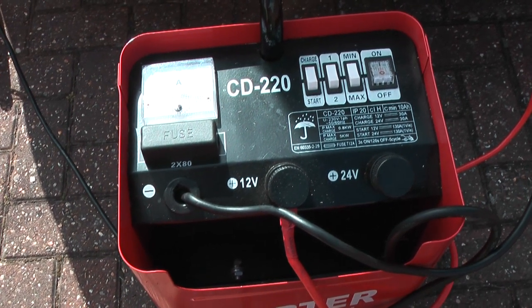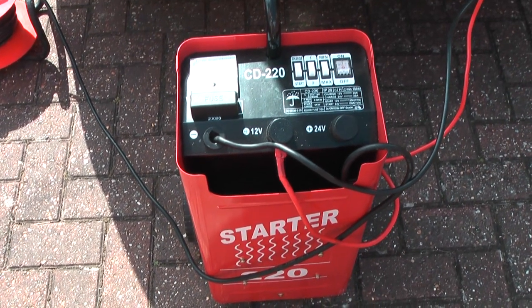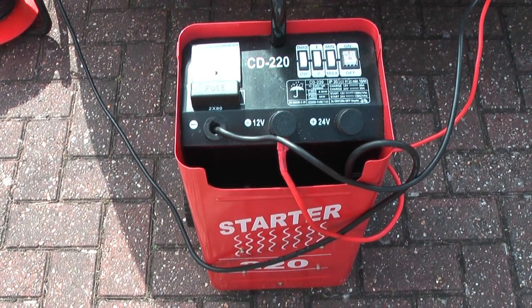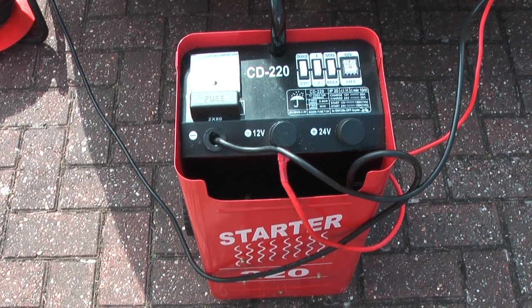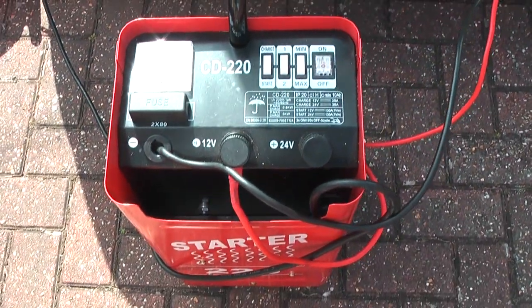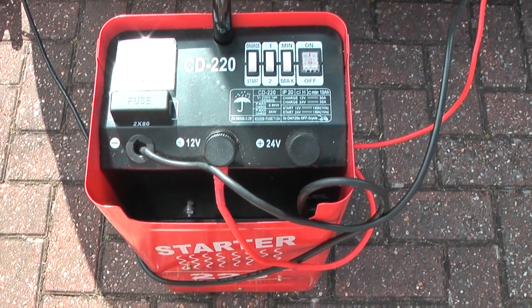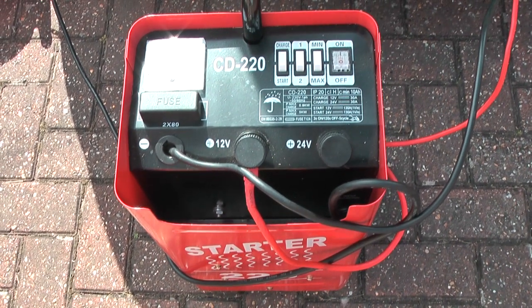The first thing you'll need is a high-current capacity battery charger. The car even on standby pulls about 20 amps or so, and if your voltage drops below about 12.5 volts during programming you'll have a serious problem. You need a juicy battery charger connected to the car at all times during programming — this one is capable of supplying at least 30 amps continuously and up to 130 amps in surges, so perfectly adequate.